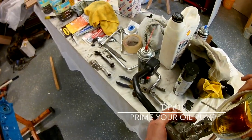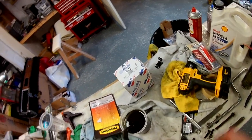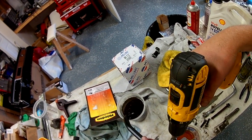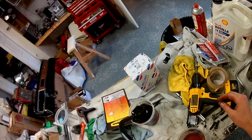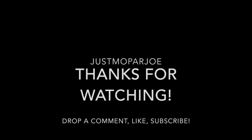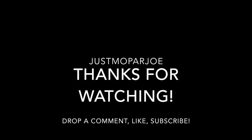Tip number 10 — this is one my dad was really big on — is priming your oil pump. I poured some 10W-30 down that section of it just to lube it, and with my DeWalt drill I go really really slow. If you spin it eight or ten times it should be pumping right through there and you can see it real nicely. If it pumps at low RPM, I know that's going to be a good pump. Thanks y'all for watching — this is just a quick video. Next time I hope I can get my oil pan buttoned up and front cover on. Thank y'all.